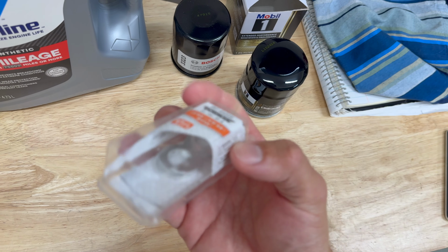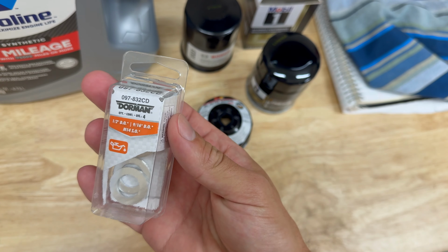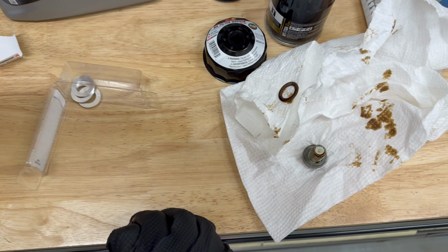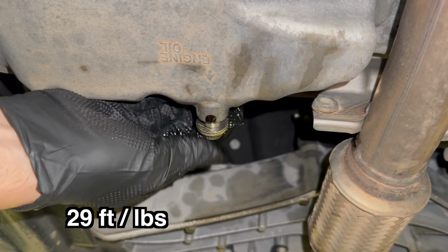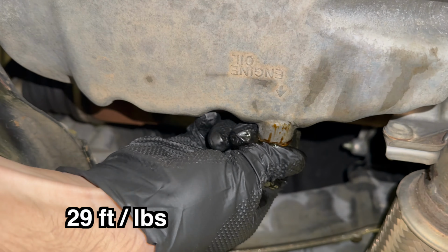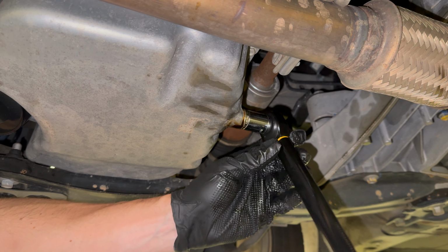Reinstall the drain plug using a new crush washer. Inner and outer dimensions, and I'll put a link in the description. Now take one of our new crush washers, put it onto our drain bolt. Torque it down to 29 foot-pounds. There we go.